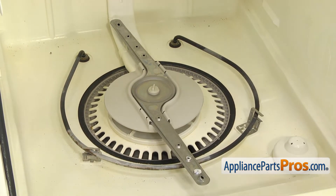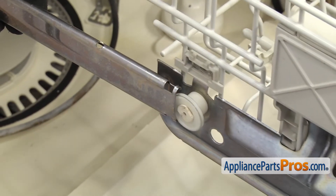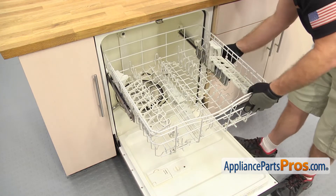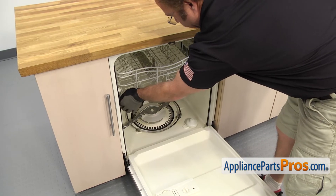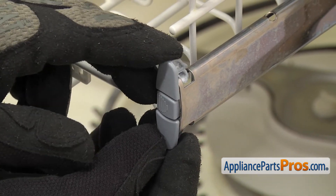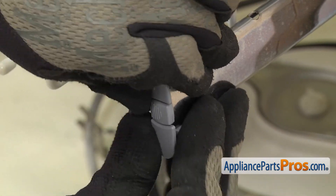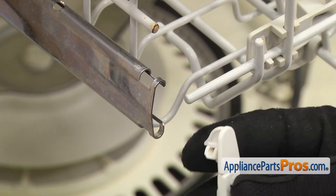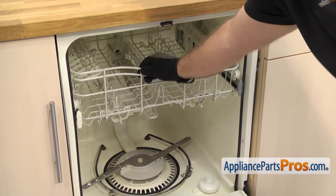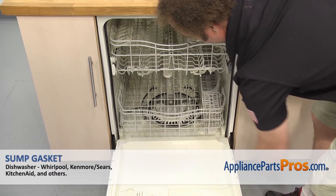Then we can put the racks back in. To put the upper rack on, we're going to pull the rails out. Once you have them out, we can line up the wheels and push the rack on. Once you have the wheels in there, we're going to push the rack all the way in. Then we're going to pull the rails back out so we can put the end caps on. To put them back on, we're just going to line them up on the rails so they go into the little notches here. Once you get them this far, we're going to have to press on the release side again so that the locking side goes on. Once you have this one on, we can do the one on the other side. Now that we have them both on, we can push the upper rack back in. Now we can put the lower rack back in — set it onto the door and push it back into place. Once you have it in, you can close the dishwasher door.